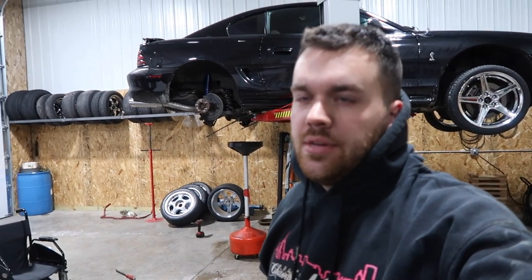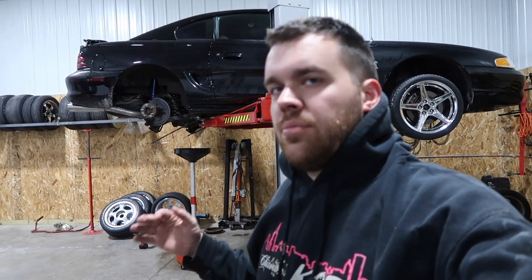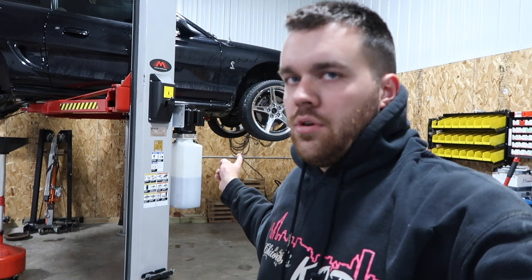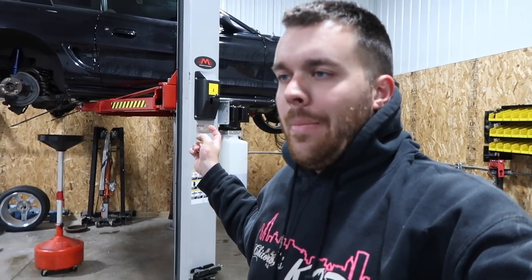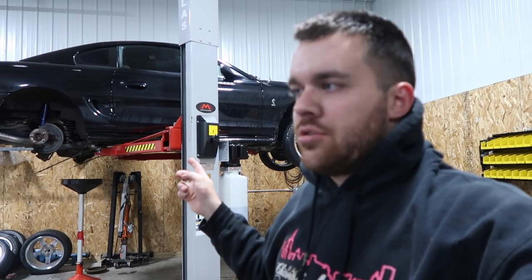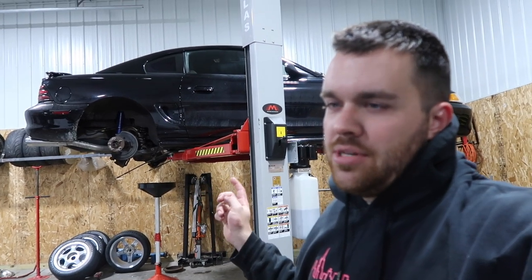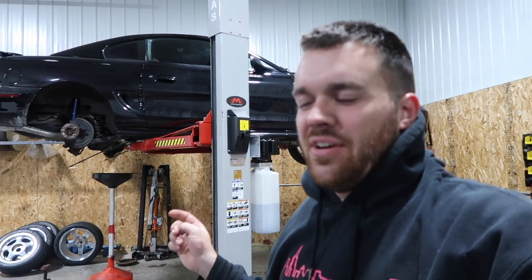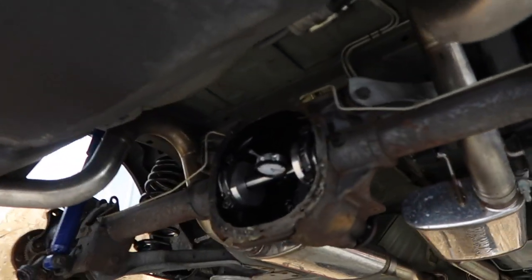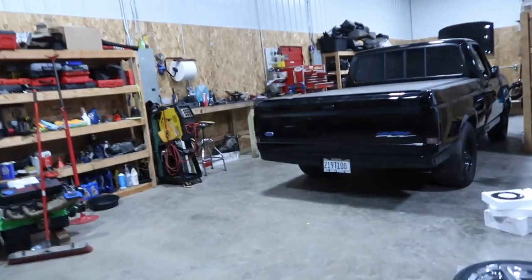1am update before we come back tomorrow — car ran and drove awesome, suspension was good. I wish it was a little lower in the front but I think it's an illusion because it's got a 255/35 versus maybe a 255/40 which would make the tire a little bit taller, so the wheel gap is a little off. I forgot to change the pinion snubber so it was bottoming out — I changed that. Then I kind of twisted his arm into putting a gear in it. It's really a dog, and I had a 3.55 brand new in the box on the shelf, so now I'm halfway through setting up the gear. The whole axle's apart, pinion depth gauge in there, pinion already in for initial mock-up, and the ring gear is bolted on.